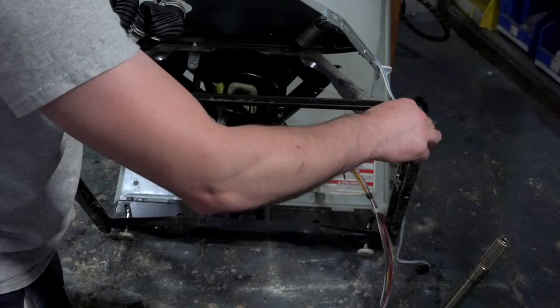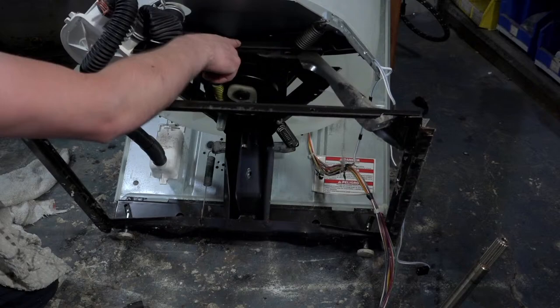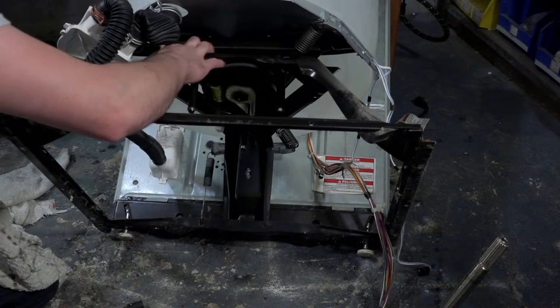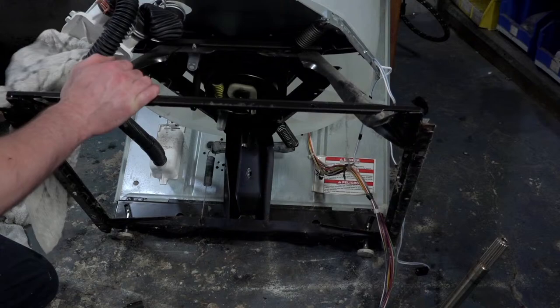One other thing that is worth checking, but rarely ever goes bad, is between the base and this triangle plate, there's these, they're called snubber pads. It's a really rare failure item, but they do occasionally go bad. These are perfect, like new condition. So if you have a lot of off balance situations in your life, then you might want to check those during your refurbishment.